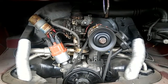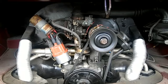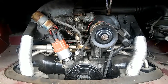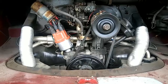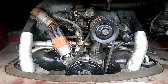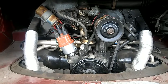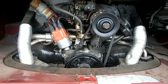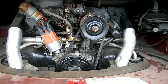If you hear pinging, slow your speed down for a while, then floor it again and check. If it still continues to ping, pull over and let it cool down. In desert heat of 100-plus degrees, that's the basic way to check that your engine isn't running hot — you don't always need gauges, you should be able to hear it. Your Volkswagen engine should never ping. If it's pinging you've got a problem — start looking at all the things mentioned and make some modifications to make it run cooler.